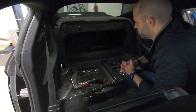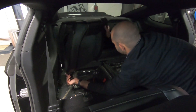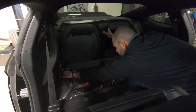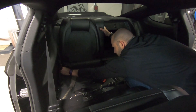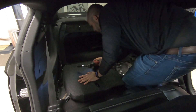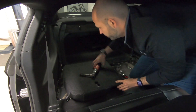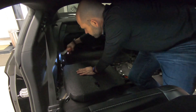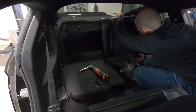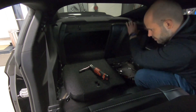To put them back in, you just go in reverse. Holding the bracket in my left hand so it doesn't scratch any plastic, pushing it into that male portion. Setting the bracket in place, threading the nut on first a couple turns. Setting the seat down and then tightening it. The reason I like to use an extension is because it's the easiest way to reach it down through here on top. Threading on the nut and letting it come down.